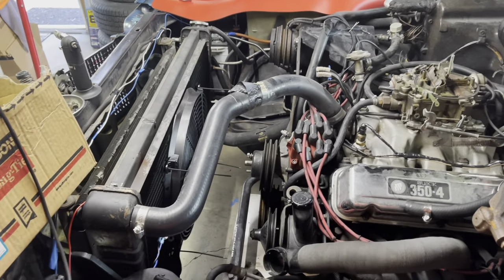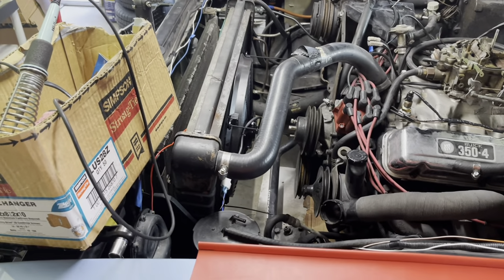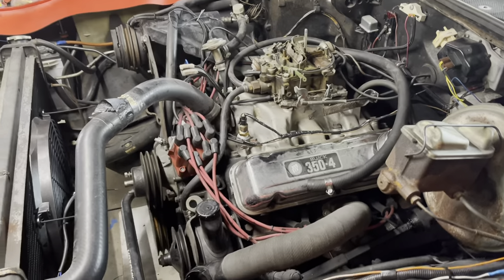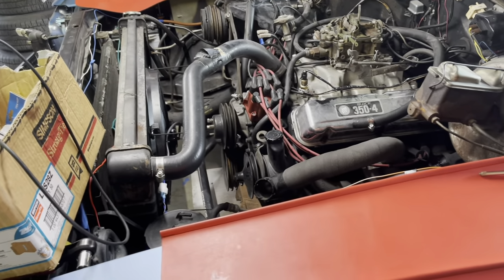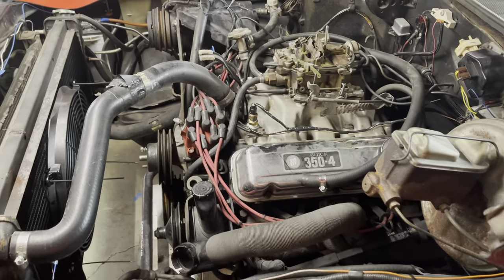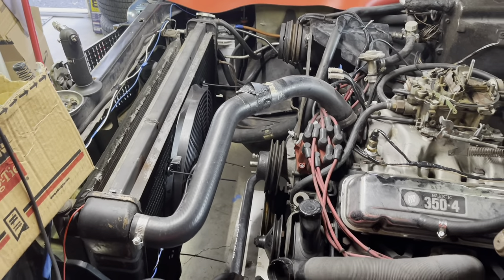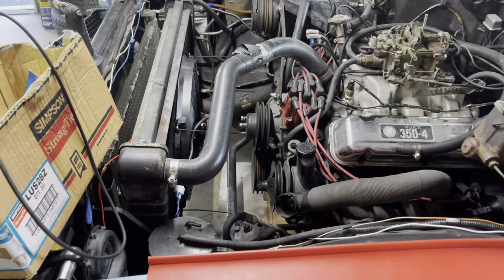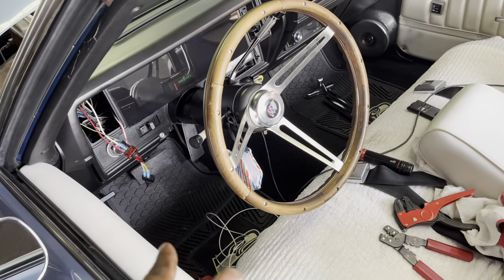I'm back here with you guys a few hours later. It took me a little bit of time to figure out how I wanted to wire it and how the pre-wired relay setup worked. So basically when the sensor senses a certain temp — which I believe is 185°F — it grounds the relay and that turns on the fan. I was trying to use that same concept but with a switch so I could ground the switch and turn it on manually. However, it wasn't that easy. I had to figure out that in order for it to work, I had to have the ground hooked up to a power source — the ground side on the battery — and then constant power from the relay setup to the battery as well, and then hook up the accessory wire to the switch.